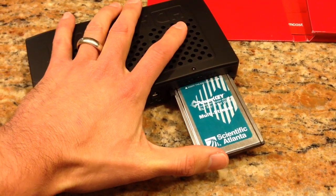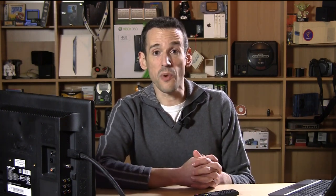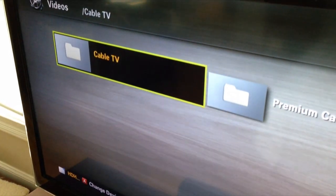I'm paying for these channels and have the cable service, but Comcast wanted to extract more revenue through box rental fees, which I didn't want to pay. The alternative was getting an HD Home Run Prime and picking up a cable card from the cable company — basically a means of decrypting those channels. The HD Home Run Prime takes that card, puts it in its card slot, grabs all those encrypted cable channels over the cable wire, decrypts them, and shoots them out over Ethernet. You can connect it to Windows Media Center, PCs that support DLNA, and even smart televisions can tune over the local area network.